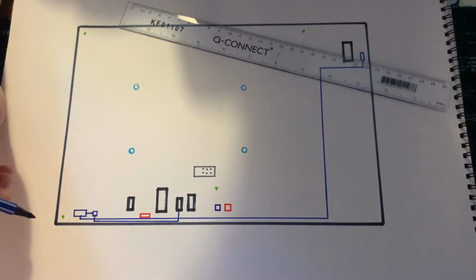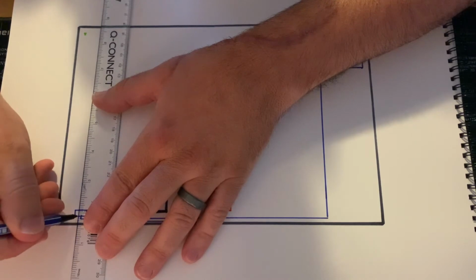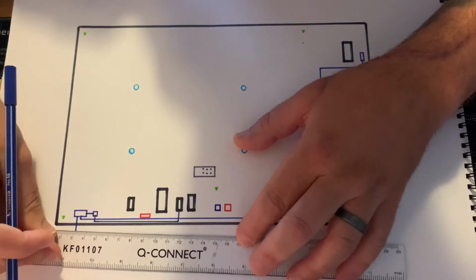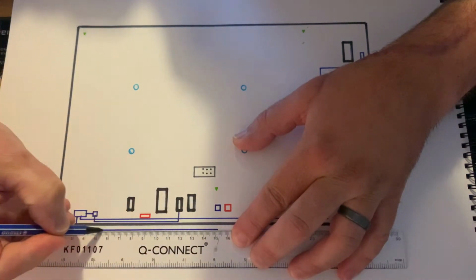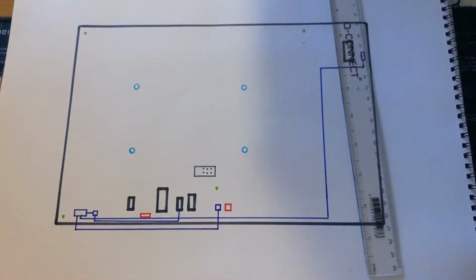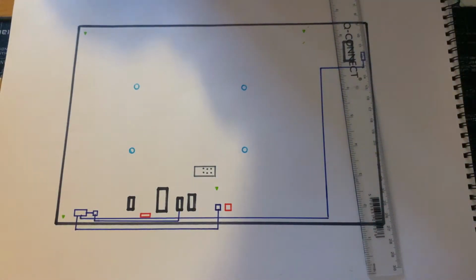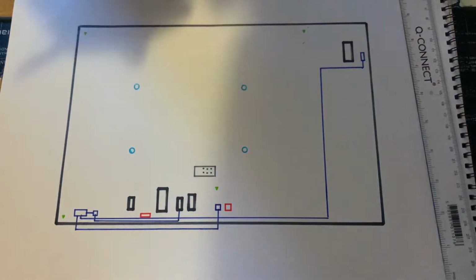Another cable comes from the consumer unit. And let's actually go outside of the van really, just to make this a little bit clear. And that runs along the side of the vehicle to a small CBE 3-pin socket that is situated just above my worktop. Again, this is very similar to a 240 plug socket. That means that whenever the van is plugged in either at home or on the campsite, it provides power all the way down to the consumer unit.